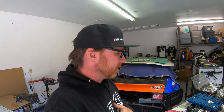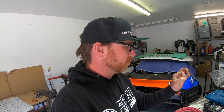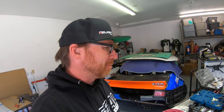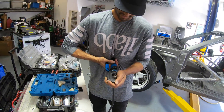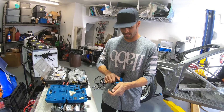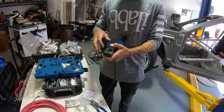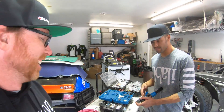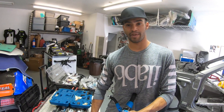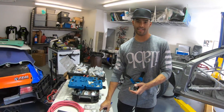I've had those connections fail before — they weren't crimped with a hydraulic crimper. I did it myself and the only thing holding it in after a while was the shrink wrap. With these hydraulic crimpers, you can pretty much hang on them — they're that strong; you'll never have to touch them again. This little tool just cuts the insulation off. Pro tip: don't ever let Matt Field touch any of your wiring stuff.